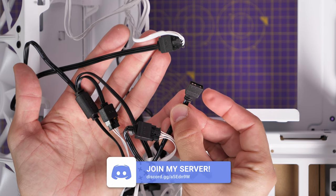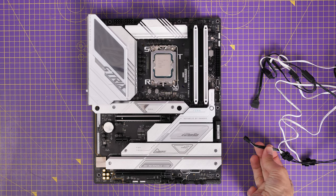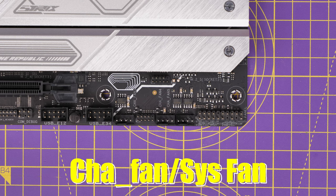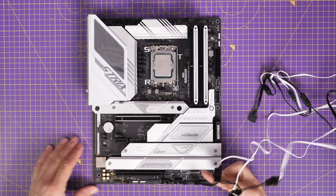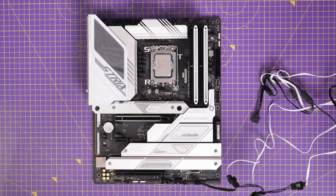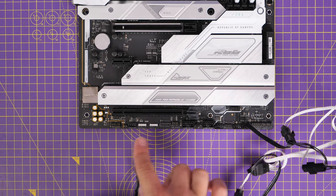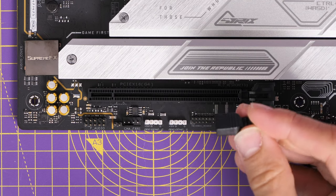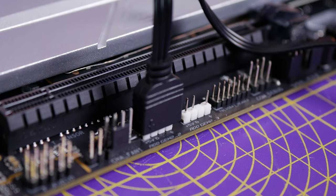To quickly demonstrate that, here's a Strix Z790 motherboard. The power cable connects up to the chassis fan or sys fan headers on the motherboard — whatever motherboard you're using, the logic is the same. The fans are powered by your motherboard, and then you have the RGB connection which connects to the 5V RGB header on your motherboard, assuming you've got one. Most modern motherboards do — there's usually one at the bottom and one at the top — so fairly logical and straightforward if that's all you're doing, but you're going to be installing other fans as well.